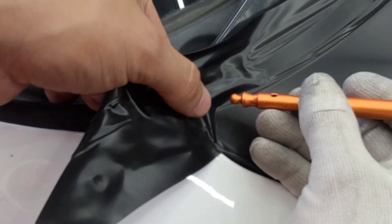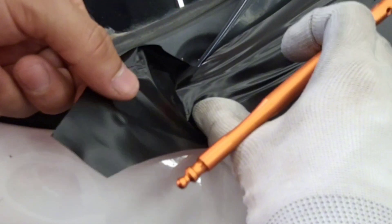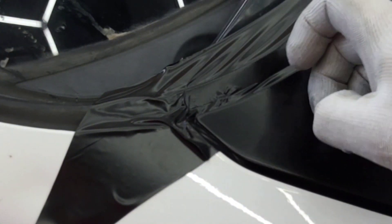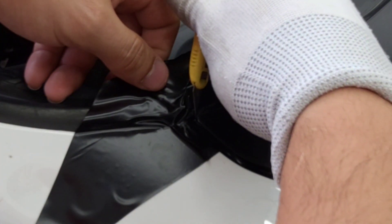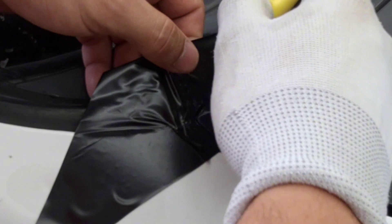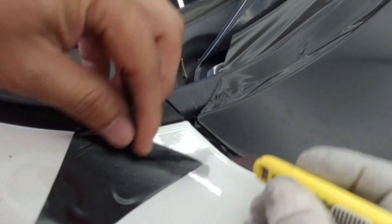Here I'm recording it a little closer for you guys. You're going to want to pull at least a quarter to half an inch over that corner, stretch it over, and create the dimple exactly where that corner is. When you shrink everything back, the sides will pull themselves taut and wrap around that corner. After everything is shrunken down and not moving anymore, cut right underneath that corner so it looks seamless. Follow the lines of the fender and the top of the hood for a uniform cut, then work the rest like any other edge.